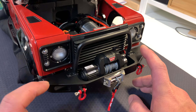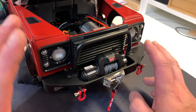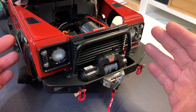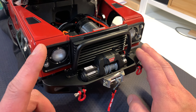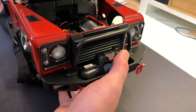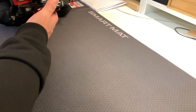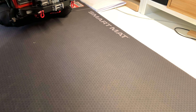I've changed suspension a couple of times already — gone from the original springs that never worked, to the Old Man Emu 70mm shocks, then tried some 80mm shocks which sat a bit high, and replaced the 70mm ones back in. I like the ride height a lot at the moment, though there is a slight issue I'll cover in another video. Anyway, thank you very much for watching today's video — I really hope the insight and information I recorded here helps someone out there make an informed decision before buying anything. Thank you and I'll see you next time.